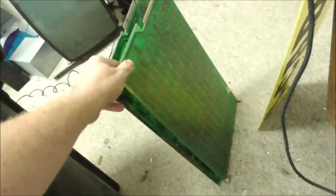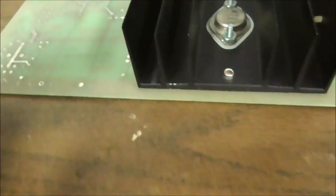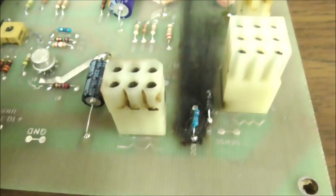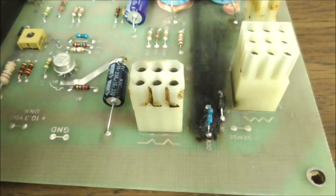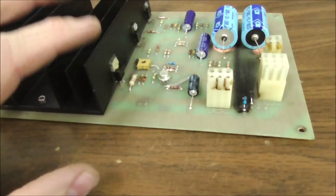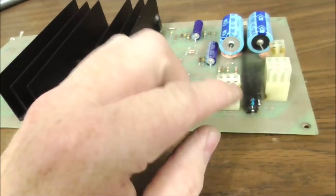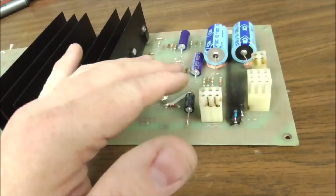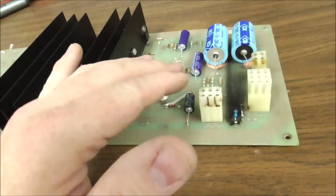The actual CPU board is two big boards that are huge and run the game — we'll do a whole other video on that. Now here's the power supply on the bench. Do you see the heat damage here? Look at this. Why is it like that? It's because the sense circuit has really screwed up here because of a dirty connection at the edge connector. Keep in mind this is likely not even the power supply that came out of this particular game — it's probably been swapped in from another one, which is common with Atari games.